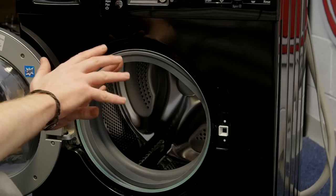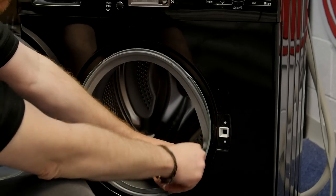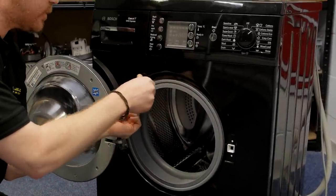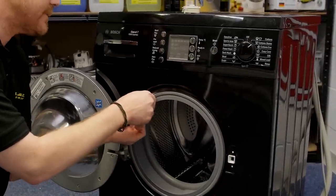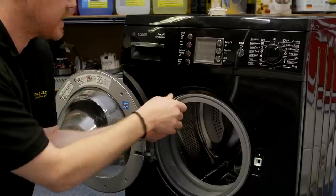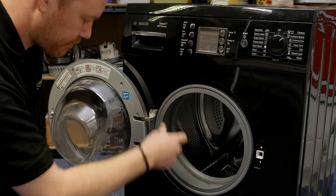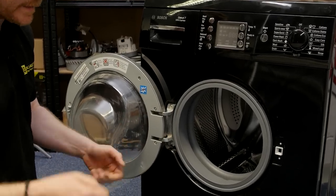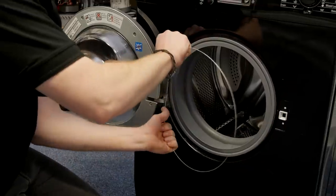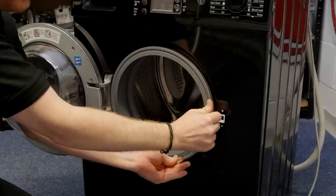I can then refit the door seal and the retaining band. If you're having trouble getting the door seal on correctly, you can use a bit of washing-up liquid and work it around the area of the door seal that comes in contact with the front panel — it lubricates it, making it easier to slip on. With the spring retaining band, it's a good idea not to put the spring at the bottom of the door seal in case you have a leak which will rust the spring. Put it on one of the sides and then work the rest of the band around the door seal.